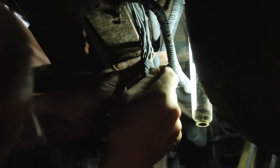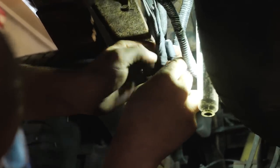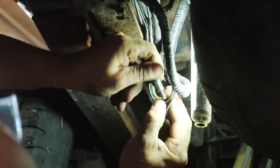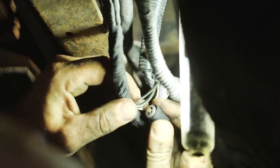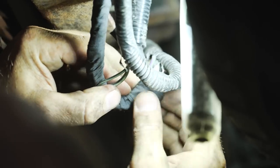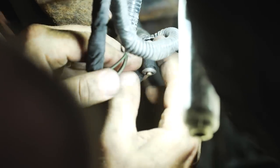I'm using Tessa tape right now — this stuff is really good. You can't rip it with your finger, you have to cut it. This is much better tape for the harshness of this area. I had a viewer send me a bunch of rolls along with zip ties meant for anchoring wiring harnesses — really cool. I apologize I don't remember your name, but thank you, I'm still using it. As I'm thinking about it, I have some fuel pump control module videos on electronic returnless Ford systems — very similar in diagnosis — so I'll link those in the description.